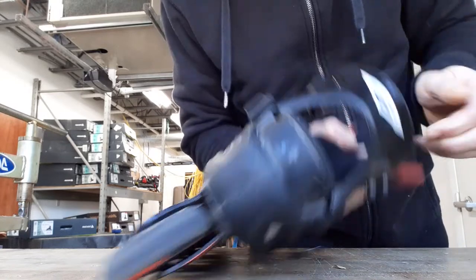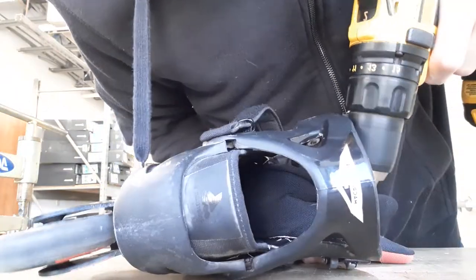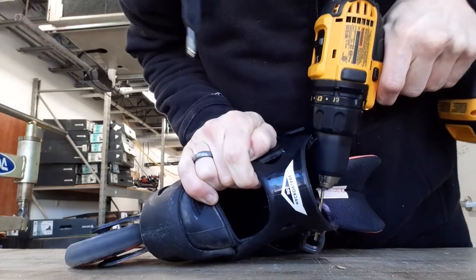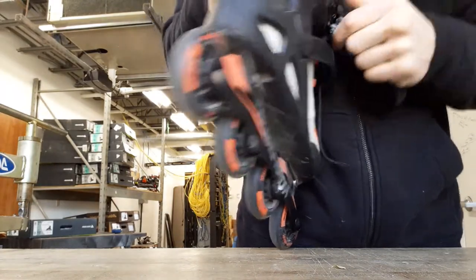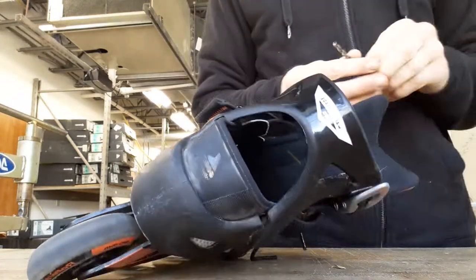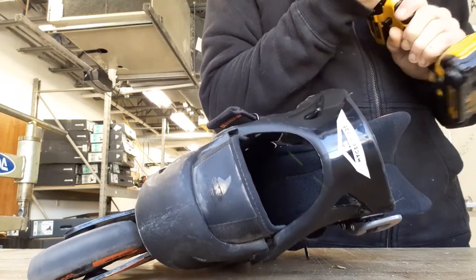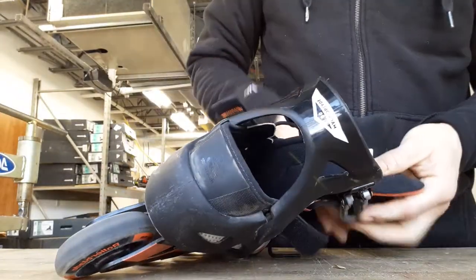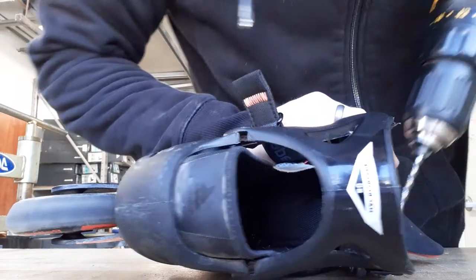I got through it but it's still not quite big enough, so I'll drill out the other one and just get a pilot hole started. Sometimes you can break it free at that point, but not this time. Let's go up in size — I think this is a 3/16. Pull the strap out of the way again. Looking at the holes, they're starting to come through but maybe not quite enough, so let's try a bigger drill bit.